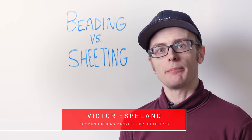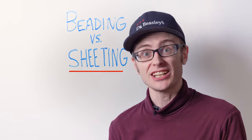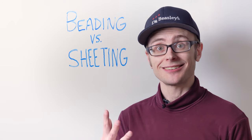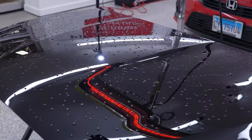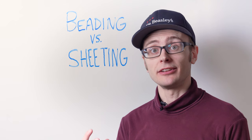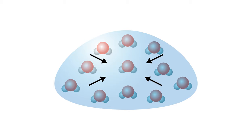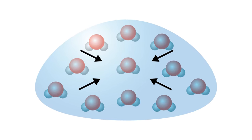When a detailer is talking about water being repelled from a surface, they're typically going to use words like sheeting and beading. When a detailer is talking about beading, they're talking about the tendency of water on a protected surface to form together into tiny little spheres on the finish. This is happening because paint protection is engineered to adhere weakly with water, so that makes the water molecules only attracted to themselves. That creates an inward force that brings the molecules together into beads of water.